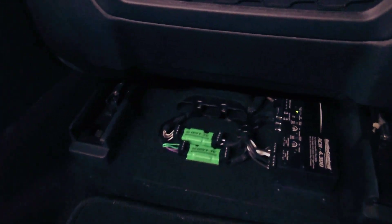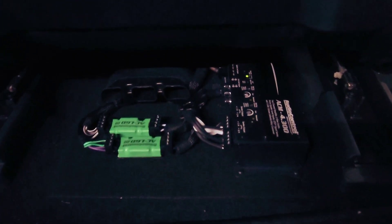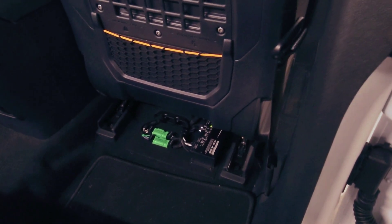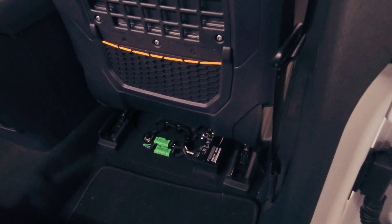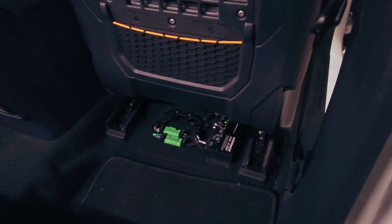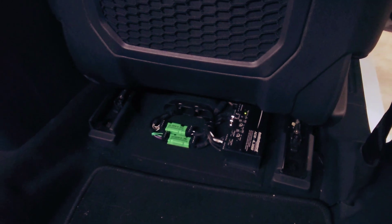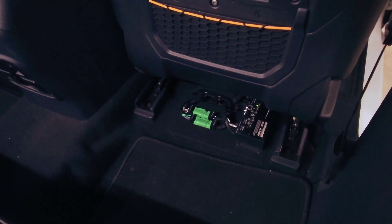Why do I need this on the Bronco and how did I find out? That's a funny story and not a fun one. Here we have the amp installed and the installation is complete. Here's the four-channel AudioControl amplifier — these are the outputs coming from the factory radio through the T-harness. They go into the load resistors, out of the load resistor, into the high-level inputs of the amplifier, and then out to the speakers. On these vehicles I always run my own speaker wire to the kicks and the dash. That way you can leave the main harnesses intact in case somebody ever wants to remove it.